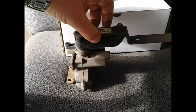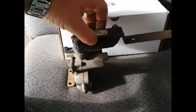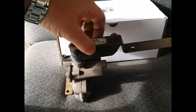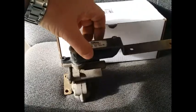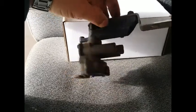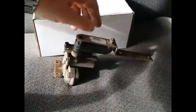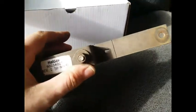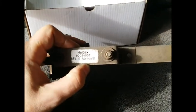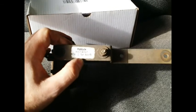So basically, how can you tell when this piece is damaged? By looking at your trailer — if it's inflated all the way to the top and you can see the base of the trailer is very high from the tires, about a foot, then you can tell something's wrong with the valve. It's old, maybe damaged, aged, wear and tear. The only way you can see is if you see this lever straight or if you see it goes up and down. If the lever is straight and your airbags are high, your valve is damaged — time to get a new one.